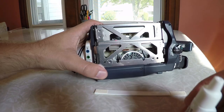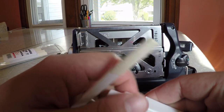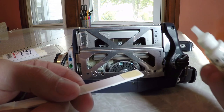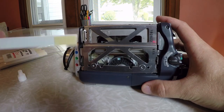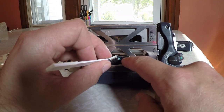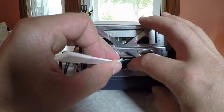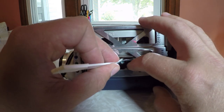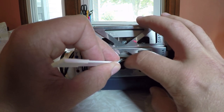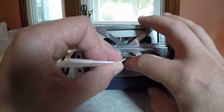What I do is take a couple of drops — let's do three — and put them on one side of the chamois swab. Then using one hand, set the swab against the video head and use another finger to spin the head. You just leave the chamois swab in place against it — don't move it vertically at all — and then turn the head clockwise a few times.